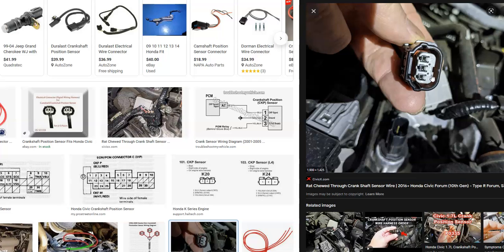You can also just check for any opens or shorts. Come in and read whether you have the reference voltage — like 12 volts, five volts, or eight volts. You'll need a schematic to know for sure what the reference voltage is, but it's always just steady voltage. If you're not getting this reference voltage, you probably have a blown fuse. That's a common problem. It's usually located inside the engine compartment, so check for that — even though it can be up underneath the dash, the engine compartment is a common location for the fuse box.